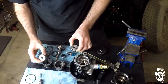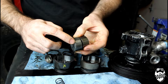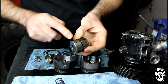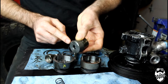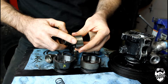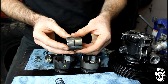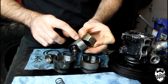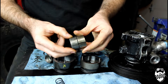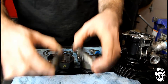The rotors themselves are absolutely identical except there is a slight edge on the WJ rotor — it's not totally flat out to the edge. The TJ rotor is pretty much straight and flat. This particular TJ pump was pretty much garbage; you can see all the marring on the rotor itself from metal debris going through it. The WJ rotor is nice and smooth, which brings us to the flow control valves.